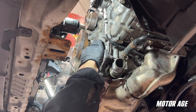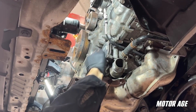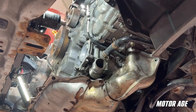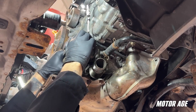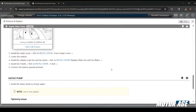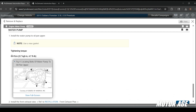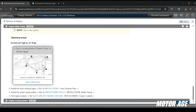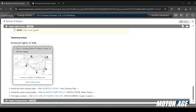I'm going to utilize some emery cloth to clean up our gasket surface and get it ready for the new pump and gasket. As you can see, we've got our pump surface cleaned up nicely. We'll go ahead and install our new water pump and gasket and snug all the bolts down finger tight. In our R&R instructions, Mitchell gives us our tightening torque specs for the water pump bolts — this is one of my favorite features. It lists the tightening torque right there in the instructions, so you don't have to go searching through pages of unrelated diagrams to find the specs you need.